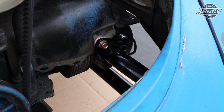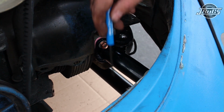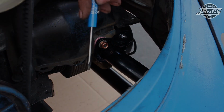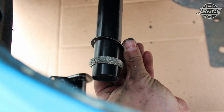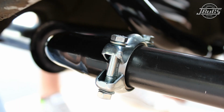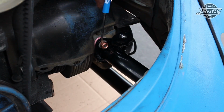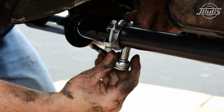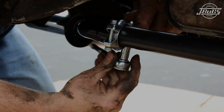Alright, installing the muffler, it's just a matter of going ahead and first lining up the J-tubes down below, with the gaskets and lock ring already installed. Make sure you got fresh exhaust gaskets, and then we're going to use the same 8mm spring washers and copper exhaust nuts that we had before. We've got everything lined up and on all the exhaust ports, so now we're just going to go through and tighten down all the nuts at the heads, and then we'll put on the exhaust clamps on the bottom tubes.